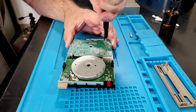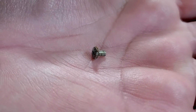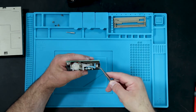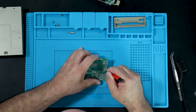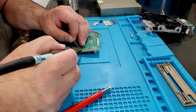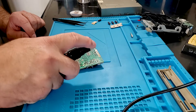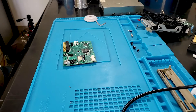When I went to remove the controller board off the floppy drive, one of the screws was really corroded — it took a little work to get it loose. Once I had the board off, I carefully disconnected all the wires; these flat flex cables can be really delicate. I cleaned what I could with a scratch pen and alcohol to get the nastiest crusties off. Recapping the board was a pain — the solder is really corroded and does not want to melt. It took repeated applications of solder, flux, and solder braid, but I took my time and didn't lift any traces. In the end it came off pretty well, and putting the new caps on just took a couple of minutes.